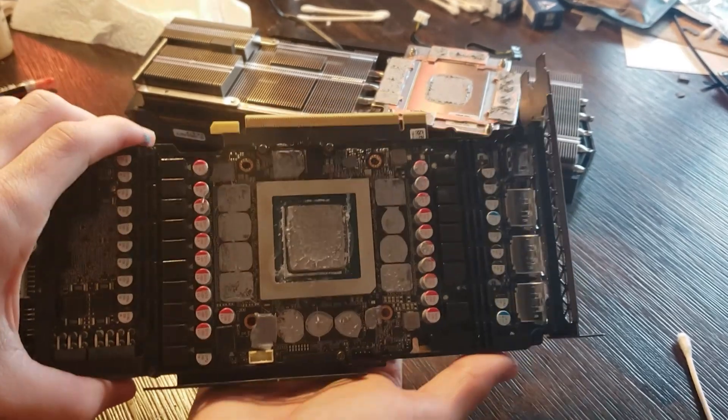Let's put this back together and see what the results are. Now that the graphic card is put back together, it's looking really good — it's actually kind of cool seeing the copper behind it. I also tested using heat sinks on the back, and honestly heat sinks help a lot. I got a big heat sink — bigger than it needs to be — but I like it because it's got a good spread. Put some thermal pads on the bottom of it and zip tie it to the graphic card, and it does wonders. We're going to test first without this heat sink so we can get accurate results, and then with it, and pull all the data together to see if this was worth it.